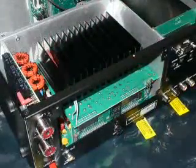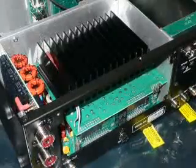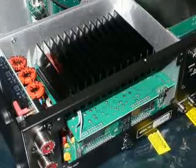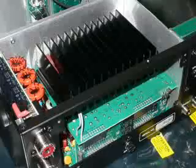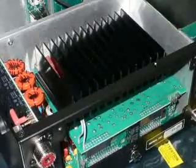If all's well, unplug the fans and then plug in the main PA module. This is secured by three aluminium lugs that you'll find on the shield around the area. The PA module plugs into the two connectors on the motherboard.